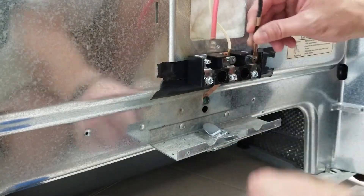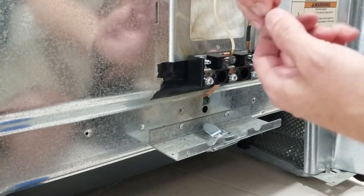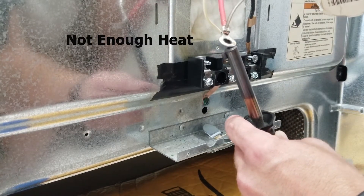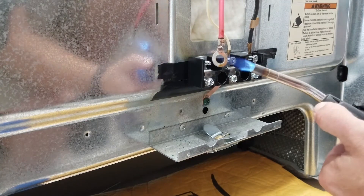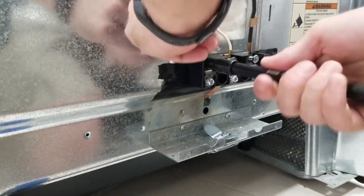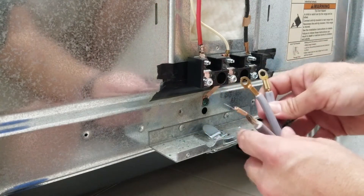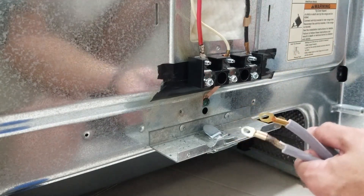Pay attention to the way your wires came off — typically the white wire is neutral and the red and black are your hot leads, but check to make sure you're hooking it up the same way it came off. I'm not going to go into how to solder in detail — maybe I'll make a video on that later. This wire here got a little hot on the inside, so I'm going to cut all that off, get to good wire, strip it back, and feed it through into the terminals the right way.